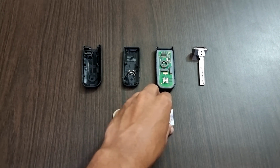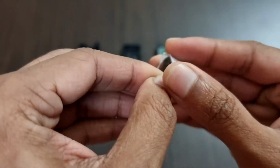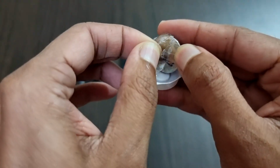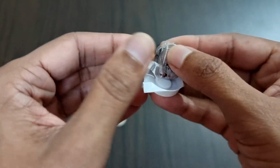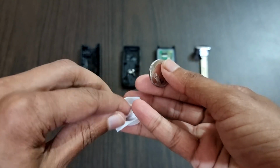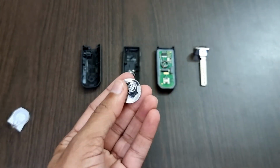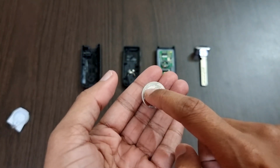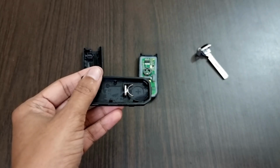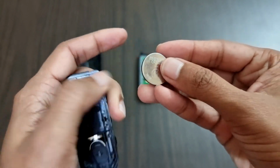I have visited a watch shop and bought the battery. So as you can see here, we can use this battery to replace the older one. Here you just need to consider something. When you pull out the sellotape like this, there will be a small amount of glue on the top of the battery. So we just need to clean it off before putting it in. First, apply some sanitizer, and using cotton we just need to clean the surface.